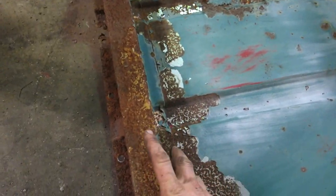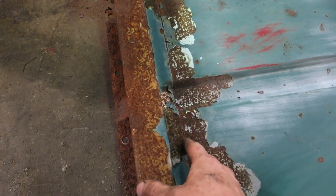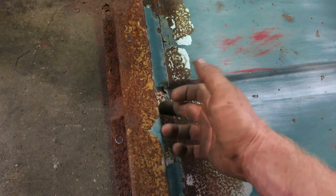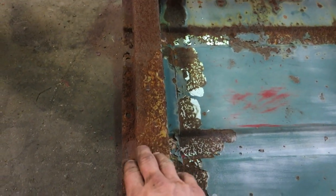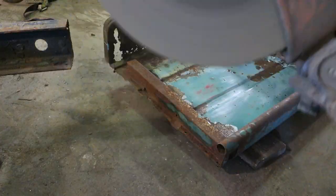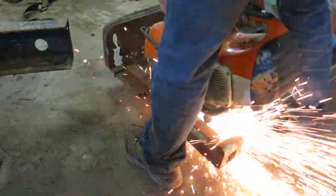I need to cut three inches off of the front to have it tied up against the cab. I'm okay with an inch gap though because four inches is to here, so I can just cut this off. I don't have to drill out all the spot welds — I can just move it over. All the bends will be right, there'll just be an extra layer there. Weld it shut again. Quick and dirty.